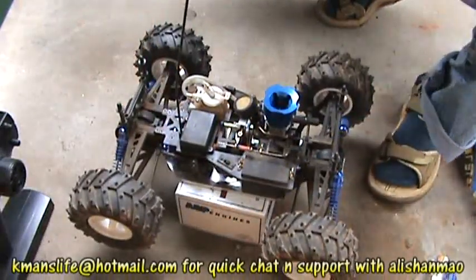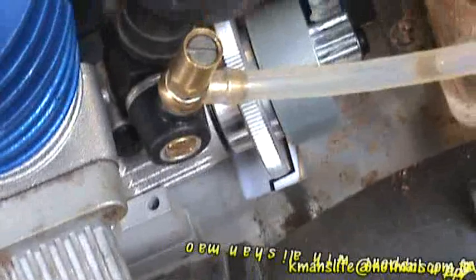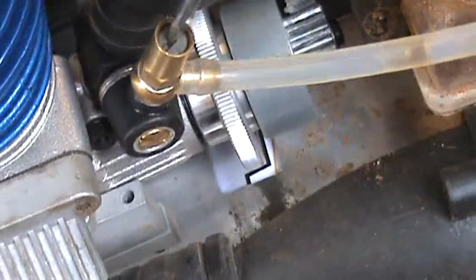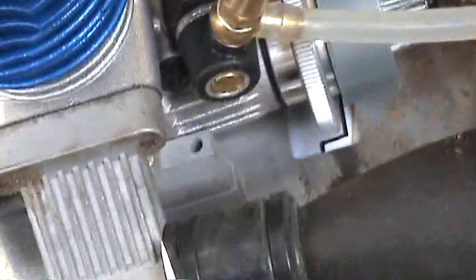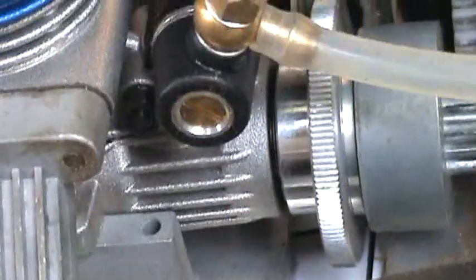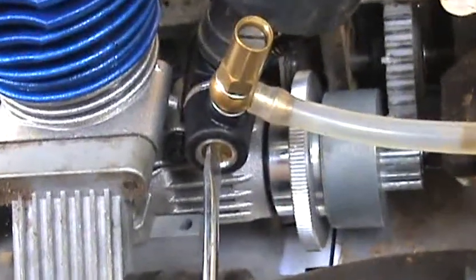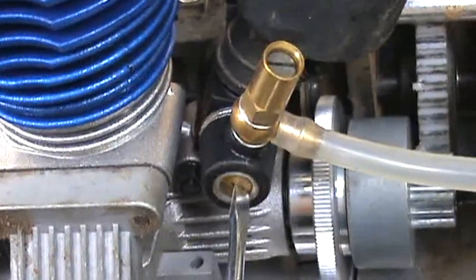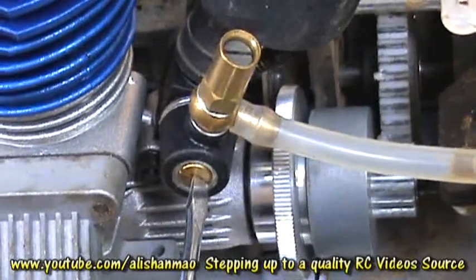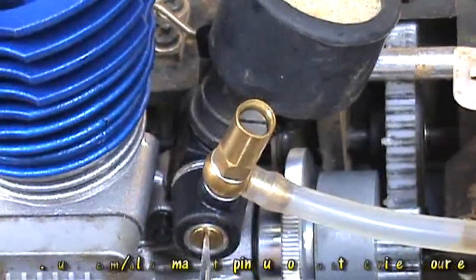Okay, the tank is refilled. First off let me show you the settings. Let's assume we have messed up the settings — say the low end is also kind of messed up. What I would recommend for the low end is that you open it counterclockwise and flush it to the edges. Just a tiny bit out from the edge is also okay.